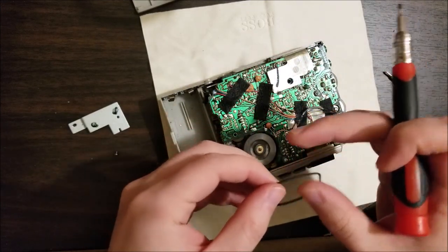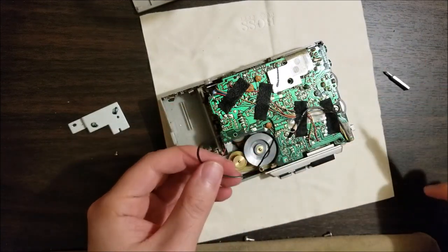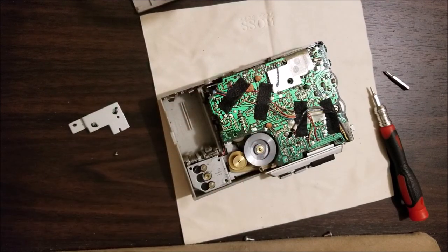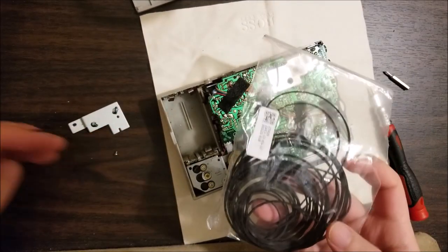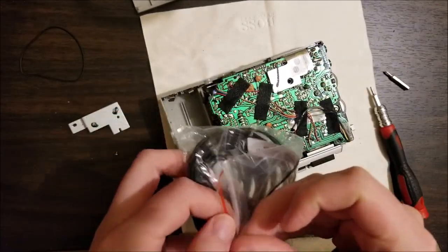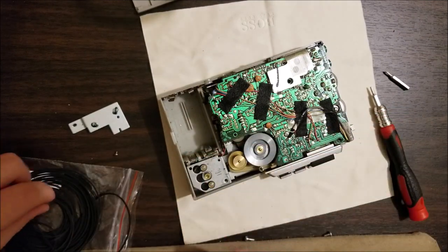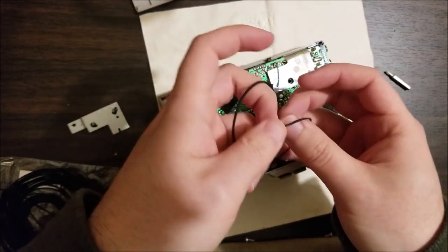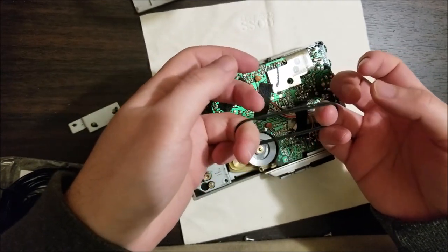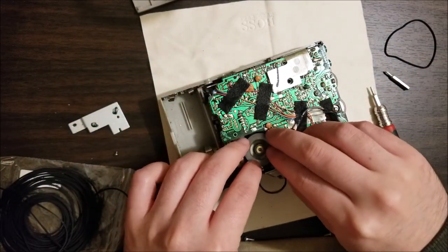It just feels different — this part feels okay, but this part is starting to petrify and get hard. So we're going to find as close a replacement as we can. I'm back with my bag of belts — I bought this off eBay, one of these belt kits with several different sizes. You're going to want the belt to actually be a little smaller than the original so that it's a little tighter. This might be a good fit — it's a little bit smaller but it'll stretch to the correct size. You can feel the tension once it's installed to decide if it's correct.